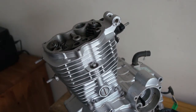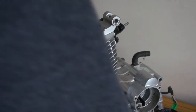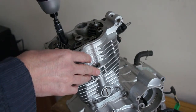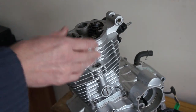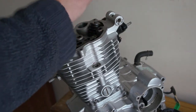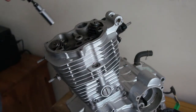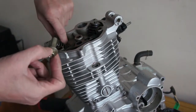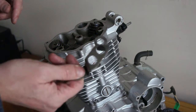So we've got four head bolts. I'm going to undo this one first — oh, that was loose. I'm going to do the opposite one. Oh, that was loose too. This corner one's got a washer on it, so make sure you put that back in the right place. There's your push rod locator or guide.